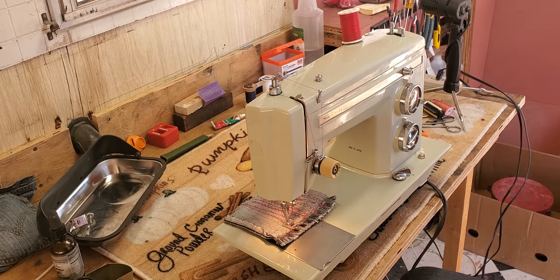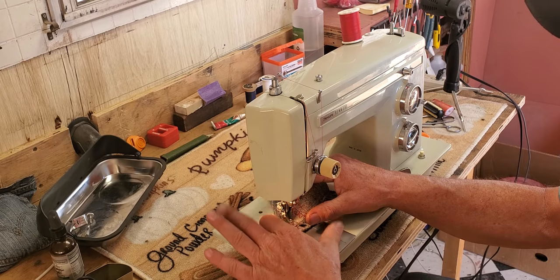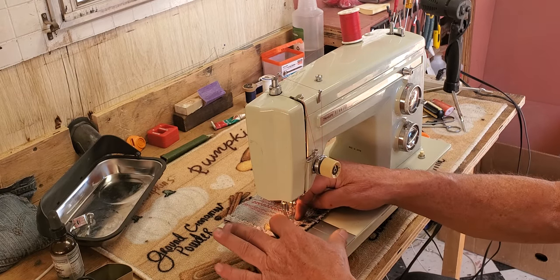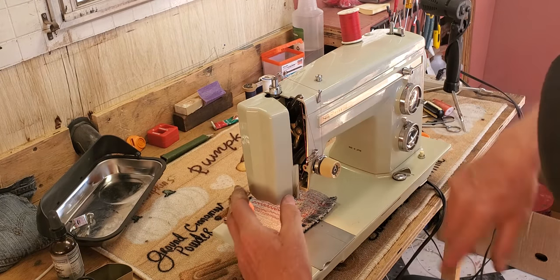You need to clean and oil your machine on a regular basis. If you're sewing all day every day, make sure you oil your machine every 3 days to a week. And to do that, you're going to want to take off the 2 screws that hold the needle plate on and brush away the dust and lint that collects around your feed dogs. And you'll open the front here and brush out the dust and lint.